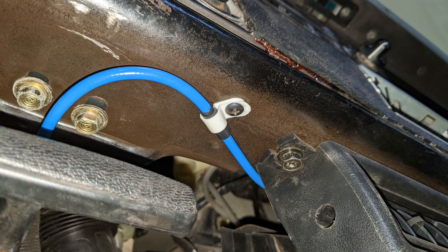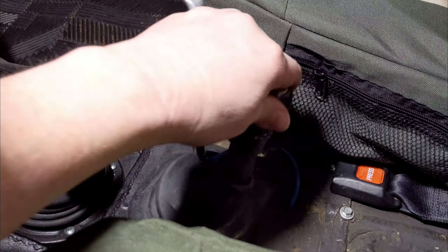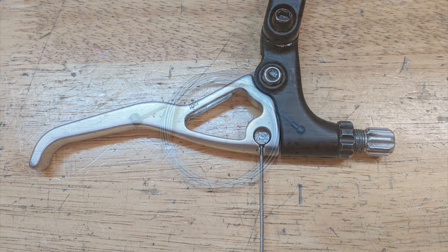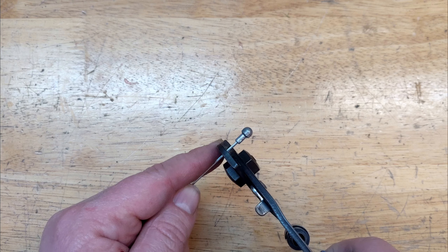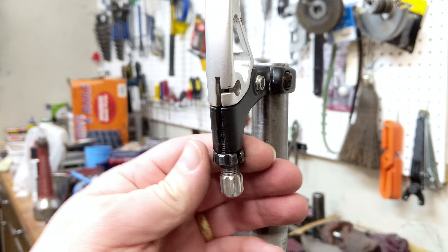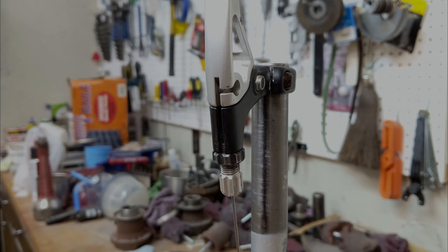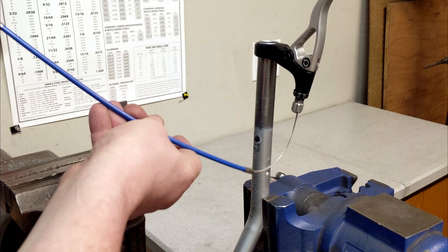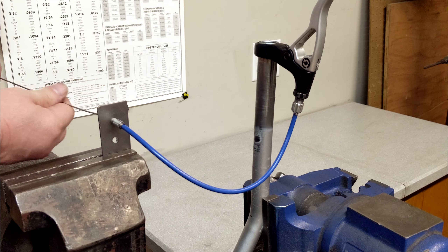If you feel the need, you can also put in wire guides to make sure the cable doesn't move around. If your hand throttle is attached to a shifter lever that's going to move, make sure you've got enough slack in the cable housing to allow travel throughout the range of movement. Now take your universal brake cable and determine which end is going to fit in your hand throttle lever. Once you're sure you've identified the correct end, cut the other one off. In order to get the cable to slide through the housing's inner liner, you need a good clean cut on the cable — this is where having actual cable cutters comes in handy. Align the split in the barrel adjuster to the split in the lever, then insert the cable end into the pocket in the lever. Turn the barrel adjuster a little so the cable won't fall back out. Now thread the cable all the way through the housing and out the other end, then thread it through the second barrel adjuster in the parking brake lever. Make sure both ends of the housing are fully seated in their respective barrel adjusters.